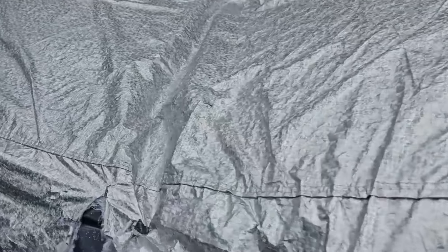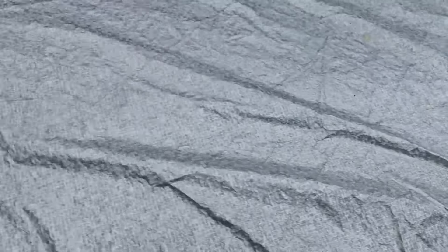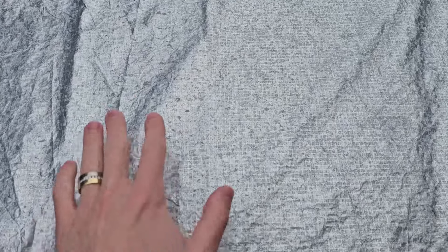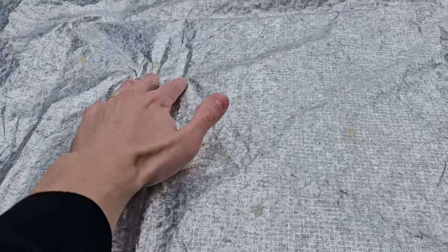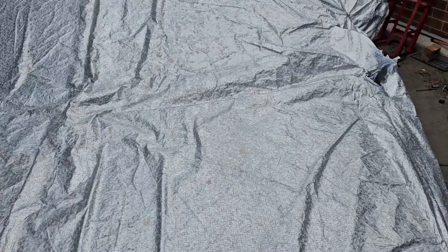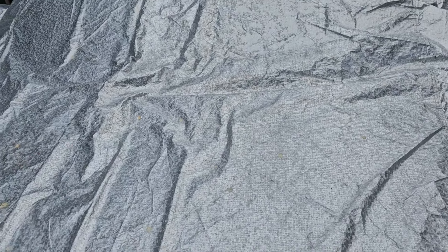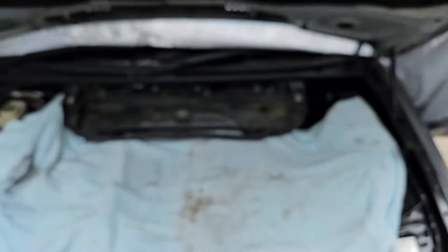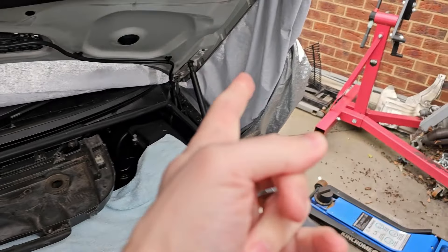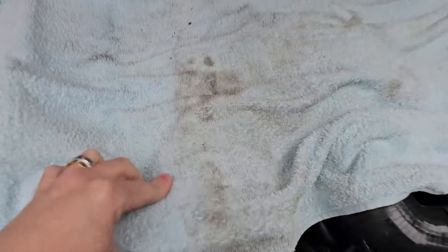That's not too bad, but look at this - whoops. The thing that really bugs me is it was waterproof for a couple of weeks, and then all this stuff starts falling off, and then all of a sudden you've got water going into the grills back here. Obviously there are grills back there - that goes to the engine bay. I don't have that drip tray there at the moment because I've got a car cover on. But what happened? Water gets down there. Thankfully I caught it early, had a look, there was a little bit of dampness, so dried it all up. I've actually got that undertray sitting on top of the engine at the moment. When it rains, this isn't waterproof anymore, so it drips through and can go into where you don't want it.